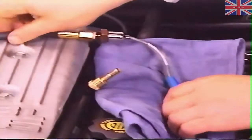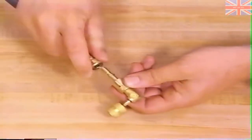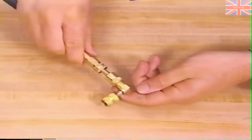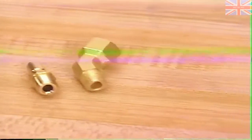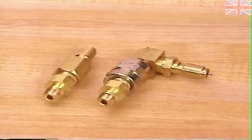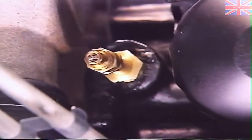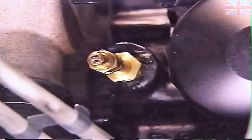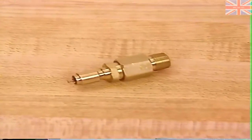Use the Schrader valve quick connect assembly with the medium pressure transducer to read fuel pressure. You'll need a 90-degree adapter along with the Schrader valve assembly to check fuel pressure on LH vehicles with 3.5 liter engines — this adapter is not in the accessory kit but will be shipped separately. A variety of fittings are used with the medium transducer for transmission fluid and engine oil pressure. For rear-wheel drive transmissions, there is a straight quarter-inch quick connect assembly and a 45-degree adapter. For front-wheel drive transaxles, use the straight one-eighth inch quick connect assembly or the 90-degree assembly. A British thread oil pressure fitting is only used on Chrysler 2.2 and 2.5 liter engines and the 2.6 liter MMC engine. The high pressure transducer has a fitting permanently attached for checking brake system pressure.